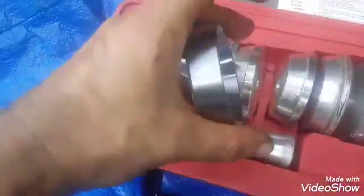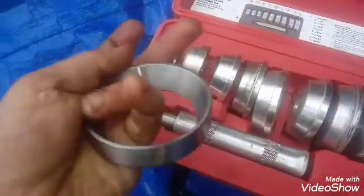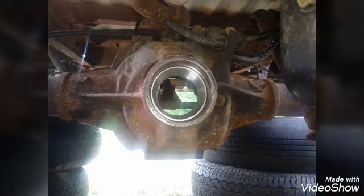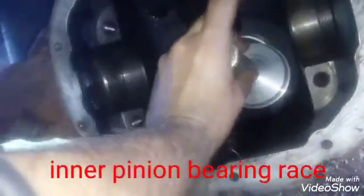None of the adapters here really fit that well, so use the old parts to install the new ones — it lines up good. Got options for hammers. A light bit of oil to the outside helps it go in. I've got the old race and I'm just tapping it in oiled up to help it slide in. For the inner race it got serious — I just needed a blunt end, so I got a big long pipe. That way I can address the pressure to any direction.